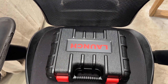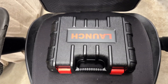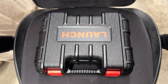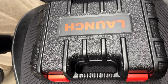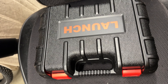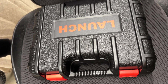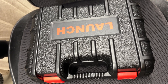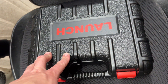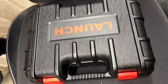Now in this Jeep, we did put a junkyard alternator on it and it's wired differently. As of right now it's still not charging the battery, which was the original problem in the first place. We put two or three alternators on it and that didn't fix it. Turns out it was the PCM not giving it a signal to start charging. So we replaced the PCM and flashed the VIN with this tool, and that worked — which is crazy because usually you need to bring that to the dealership.